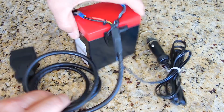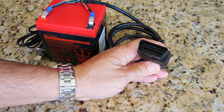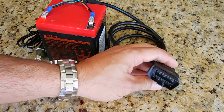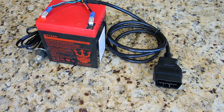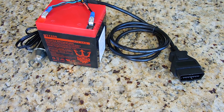To use this device, plug it into your vehicle's OBD port, then set your ignition switch to the accessory-on position. Go underneath the hood and disconnect the battery cables — make sure they do not short out against each other and do not touch chassis ground. Install the new battery, tighten everything down securely, start up the vehicle, and let it idle for about 5 to 10 minutes. Then you can unplug this. And that's it.